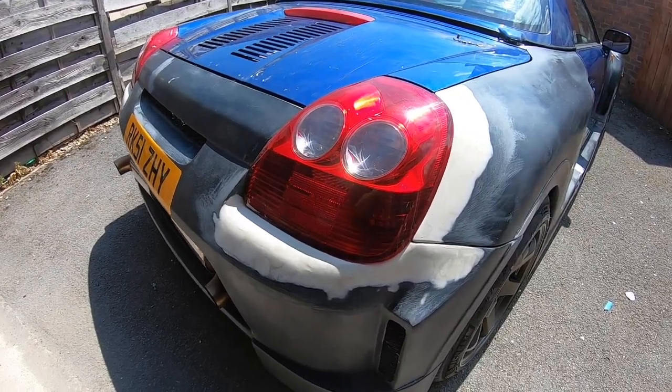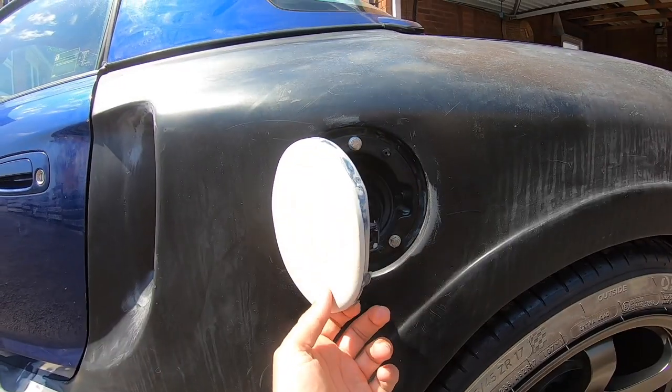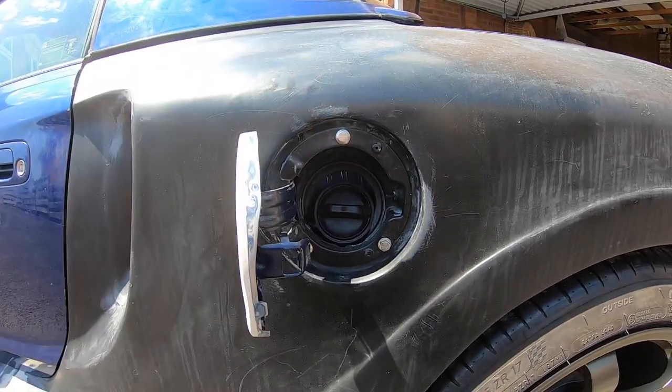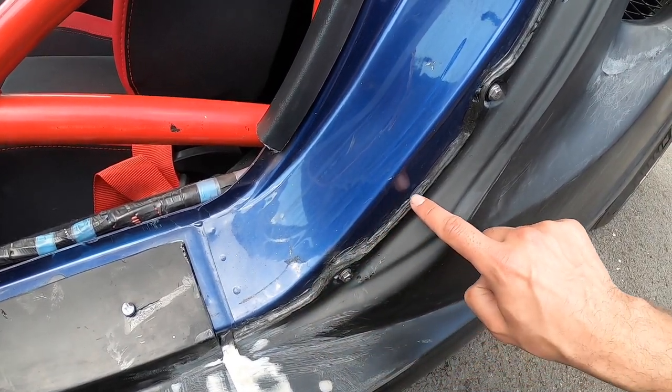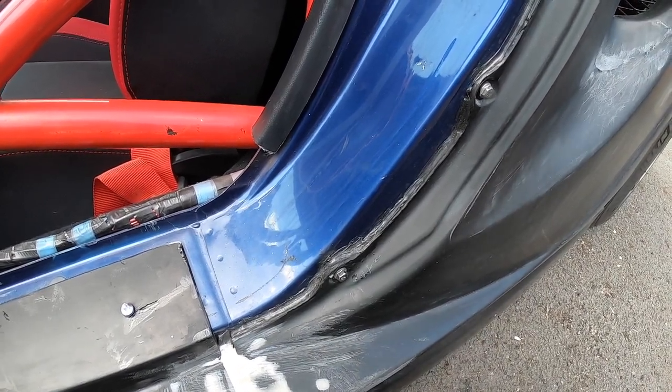Around the back of the car I've done the exact same thing with the rear lights, and the fuel filler cap needed quite a bit of work as well to raise it and meet the level of the kit. Behind the edges of all the panels that aren't bumpers I put a silicon sealant which just really settles the part on the car.